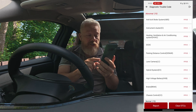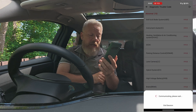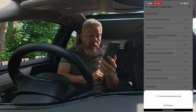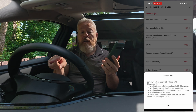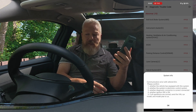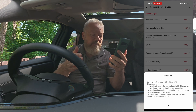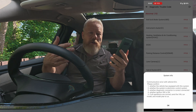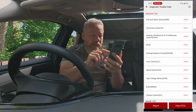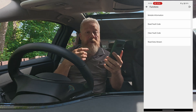I know the main thing that's causing the issue is the parking distance set control sonar. So if we click that one there, it says communicating, please wait. I don't know why it's coming up as an error all the time. My car's gone off — that's why. My car has actually gone off. Let me just turn the car back on. I've had the car on and because it's just been in, you know, not fully on but on — let's try again now it's on. There we go. So it was my fault, not this thing's fault. It was my fault because the car turned itself off.